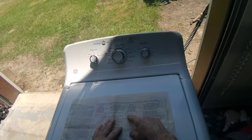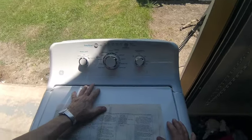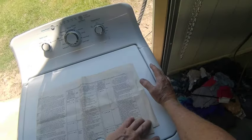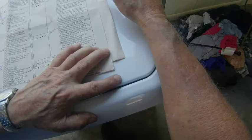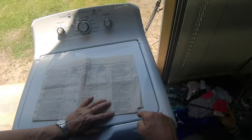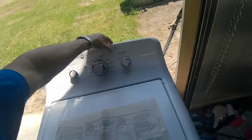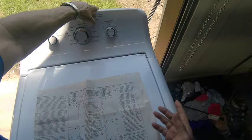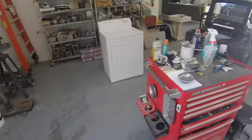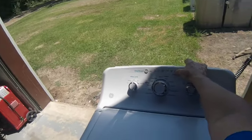This test is not testing the lid lock — the only way to test the lid lock is the spin test. One more click clockwise and all three of these come on. Wait for it — it goes through its algorithm. It will need two sprays of water before locking the lid. I can hear it clicking, clicking, but it's not locking. So we just figured out what's wrong with this machine — it's the lid lock. It should show the lid lock and it's not. So let's get out of this test. We can't do the agitate test either. Just going through that test we found out the lid lock is defective.